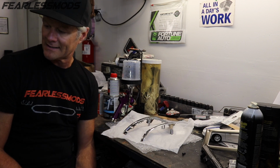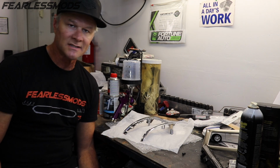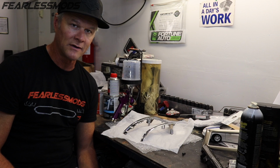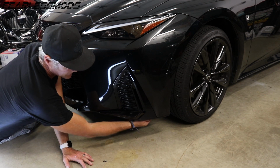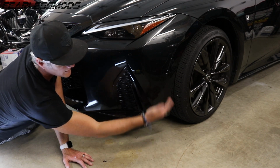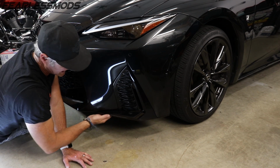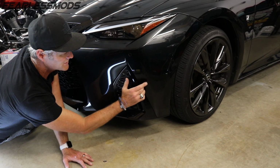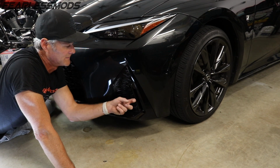Next thing on our list of painting is the accents on that front lower bumper. So I'm gonna have to see if I can remove that trim piece, which hopefully is only on the outside, and we'll try to figure out those clips as well so we can prep that. Okay, so I've done a little bit of investigative work here, and I think there's a couple access points down here I'm gonna check into with maybe some 10 millimeter bolts in there. I'm probably gonna have to turn the wheel to the right on this side so I can see what's connected back here at the back, but it looks like this piece should come off from underneath and then hopefully just some clips here. But worst case, we got to pull that fender liner back a little bit and see if there's any other attach points in here.